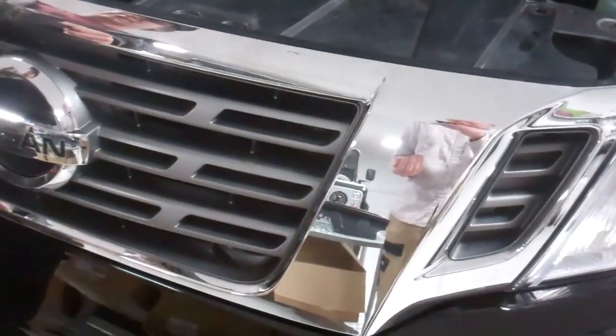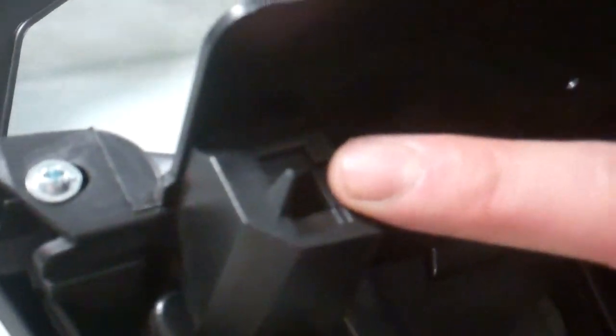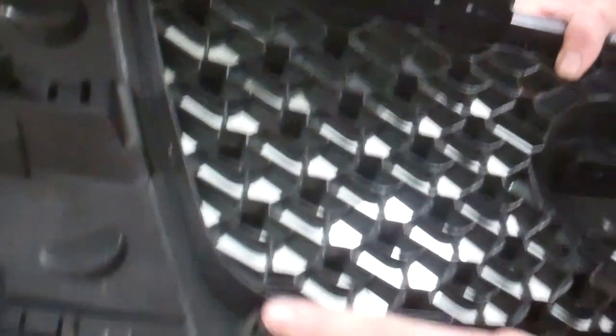Right, so when you've got your top plastic fixings undone, what's the plan then, Ian? Now, it might be easier to show you on these. These don't have the clips in, but there's two fixings that go onto the headlight, down each side. Then you've got a series of fixings along the bottom. So how do those headlight clips work? You've just got to give them a squeeze.